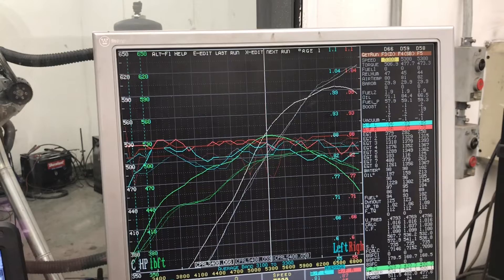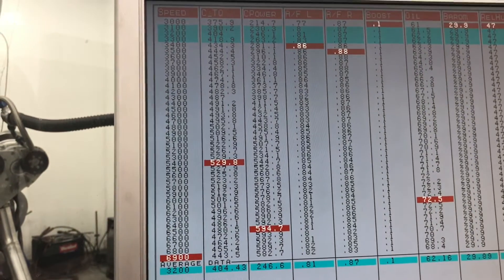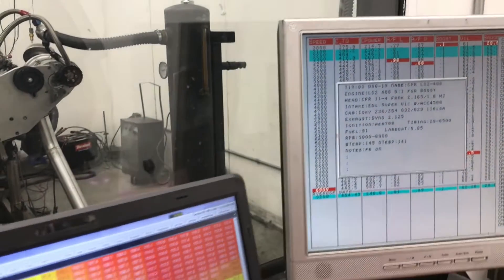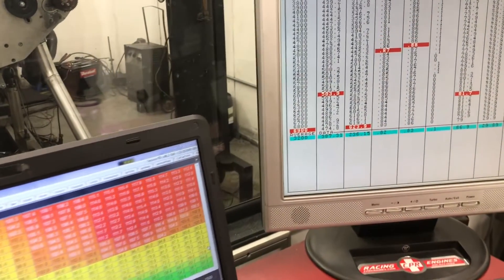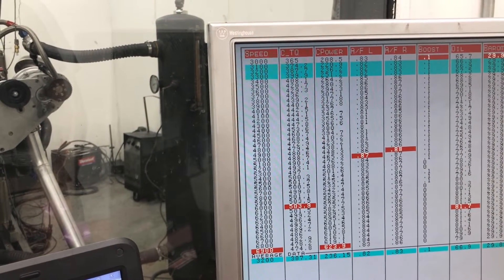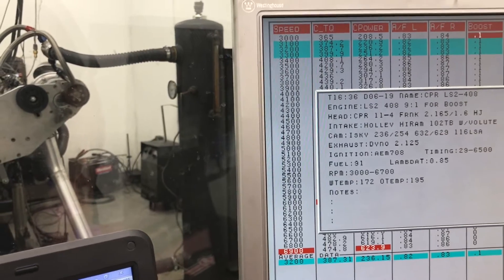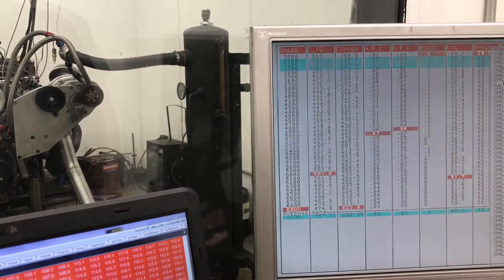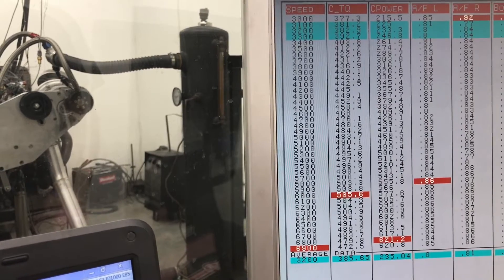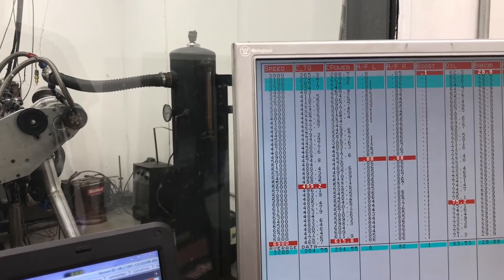The boost is going to carry it over anyway. Here are the numbers: 529.8 foot-pounds of torque and 594 horsepower for the stock LS3 intake. The Edelbrock XT really shines in the 6,800 to 6,900 RPM range — 503 foot-pounds of torque and 623 horsepower, so we gave up torque to gain top-end horsepower. The Holley Hi-Ram final numbers were 505 foot-pounds and 621 horsepower — pretty much the same as the XT. And the Super Victor suffered substantially down low.